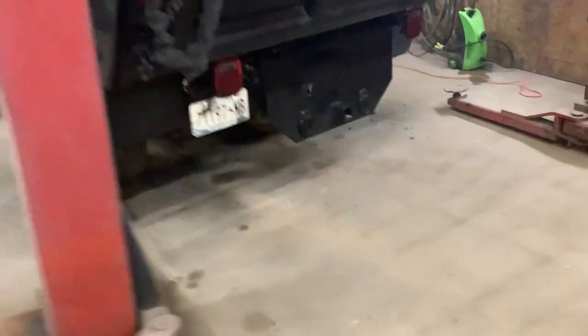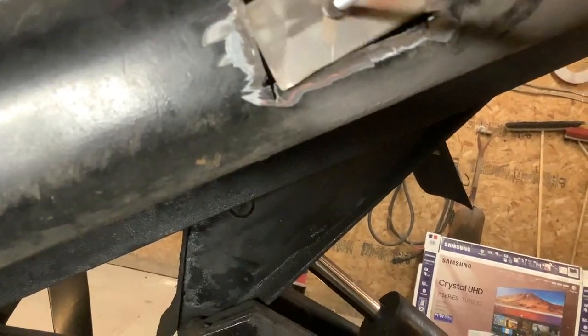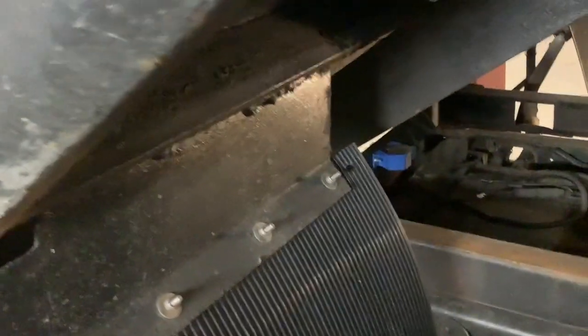While I was cleaning up the box, I found a pinhole over here and I went to sanding on it to grind it — and oops. So I'll take a new piece of metal, see if I can get this in. I'll weld that in, spray it with weld-through primer first, and then I'll put that in and undercoat it.